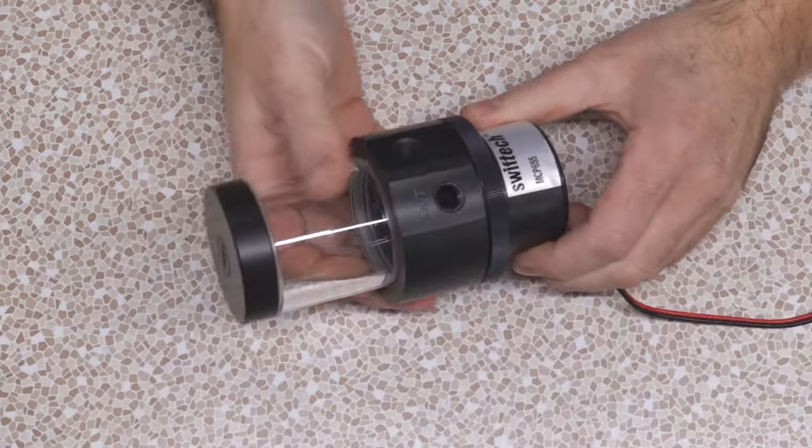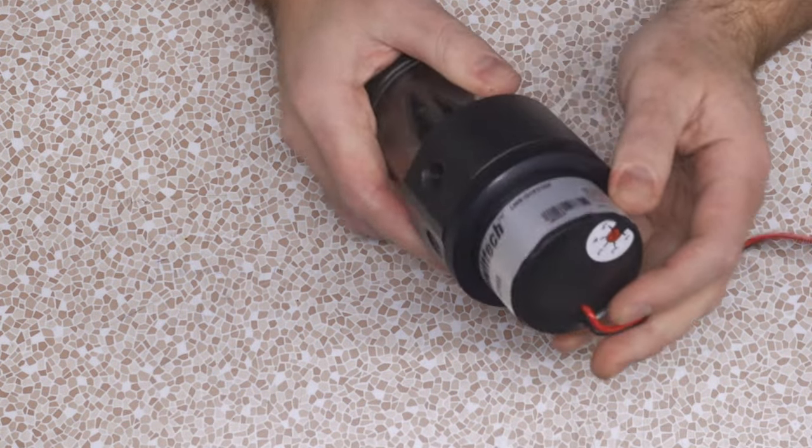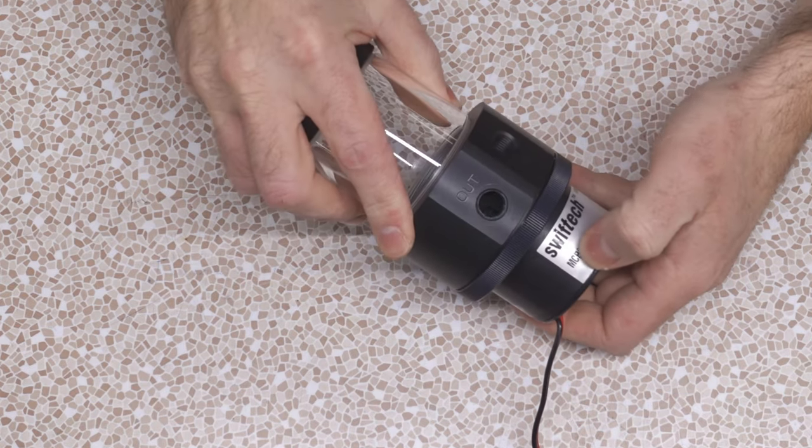Now the rest of my water cooling components are kind of scrapped together. We're going to be using a bog standard EK Res with an adjustable D5 pump. Actually the SwiftTech MCP blah blah blah. The actual EK pump is in my good system. And for the radiator, because that case I'm using doesn't officially support water cooling, I can't put a 240 across the top because there's not enough clearance. You can't really put one on the front because there's not enough airflow. The only place you can put a rad is a 120 on the rear.